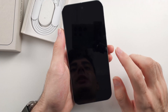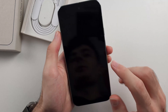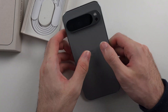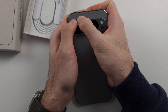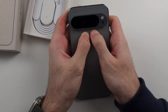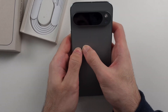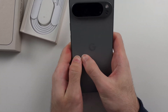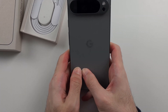The second reason why your Pixel isn't turning on is because the battery cable or display cable has unplugged from the phone. We can fix this without opening the phone. Get two thumbs and push as hard as you can all the way across the back of the phone, including the cameras. We're looking for a loud click sound, which means the cable has been plugged back in.